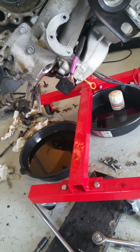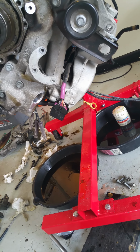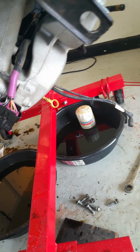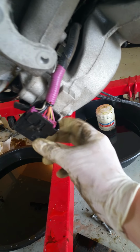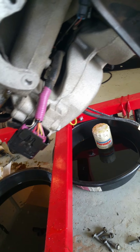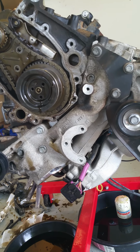But one thing I would stay away from is the fact that GM's wiring harnesses were absolute garbage on these G6s. Because this engine and the one I put in the car, this insulation around the outside shatters, it crumbles. And it's not even in a hot spot. The ones that are in hot spots, those harness parts are actually fine. And things like your hookups, it's a 2009 G6, and the plugins were crumbling, barely touching them, they'd crumble. Hopefully the GM vehicles nowadays are better, but I don't know. It's enough of my rant.